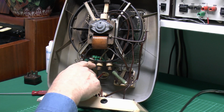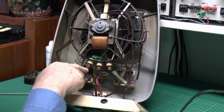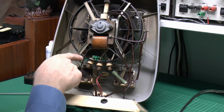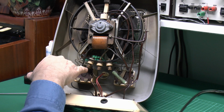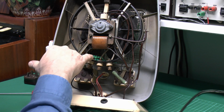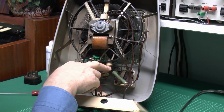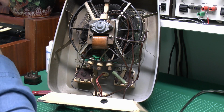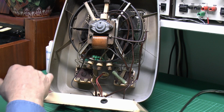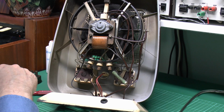And at the bottom here we've got the three insulated terminals for the heating elements. There's three of them because we've got a common here, which you may have seen has two of the wires attached, and essentially it's got three heat settings. One of the elements powered will be doing this pair, the other set will be that pair, and then for the full heat both elements are activated, and that's still the common one over there. It's arranged so that the two elements are not the same rating, one being higher than the other, so you get a 1, 2 and 3 heat setting.